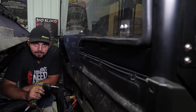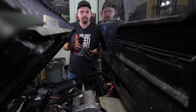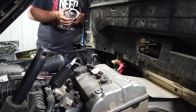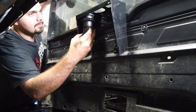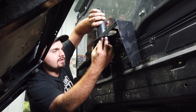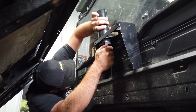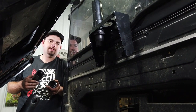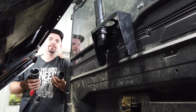Next, install the riser tubes and fittings. Grab the riser pipe, the fitting for the riser pipe to the hoses going up to the snorkels, and the lock nut. Thread the lock nut down onto the fitting about three quarters of the way, then come over to the bracket, slide it through, and thread it on until tight. Make sure the lock nut is up against the bottom side of the bracket as you tighten. Apply a good healthy coat of silicone into the threads of each coupling to help them stay together. Install the other two riser pipes and fittings the same way.